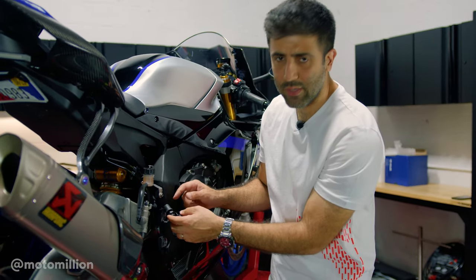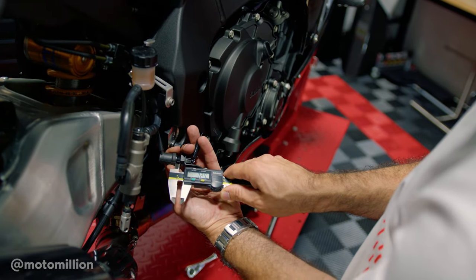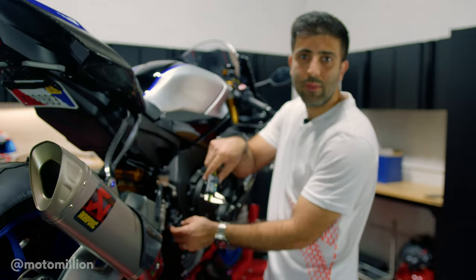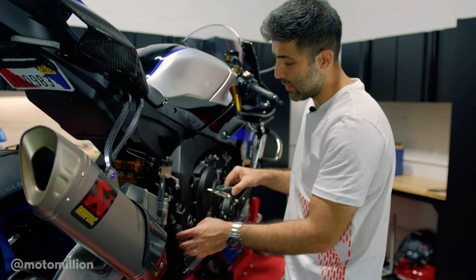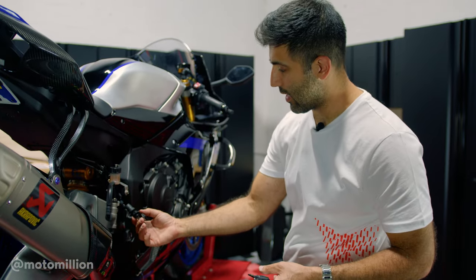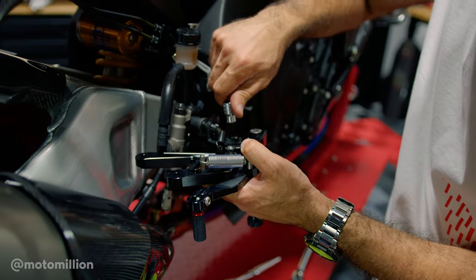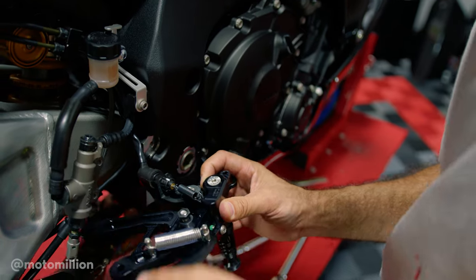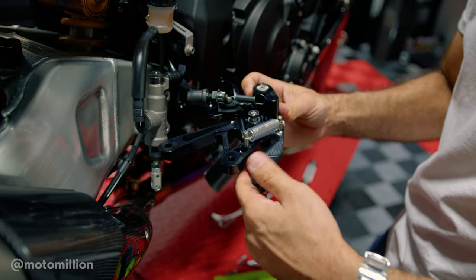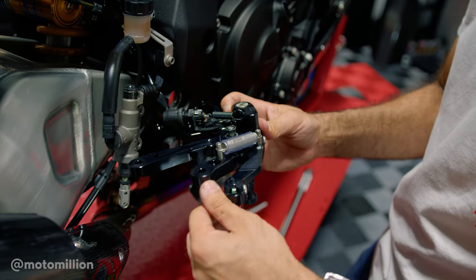It says we've got to measure something here, so I'm going to get my calipers as well. We have about 7.39 — I'm going to install it at 7.3 to 7.4 millimeters and do the fine adjustments after. That's all for the actuation of your brake light. This is just a mechanical switch that Yamaha has on there. So when you step on your brake lever, this pulls the switch and your brake lights come on.